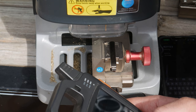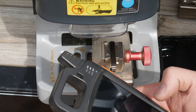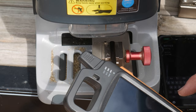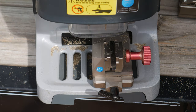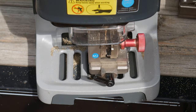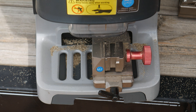Four, four, three. Four, two. Four, three. Two, one, three. Find bitting. Okay, so that is a valid key code. I don't know if it's the right key code or if my A and B could be reversed, but what we're going to do is cut a key and try it in the door. We will cut the key — cutting the other side. So we have a key now that has been cut. I forgot to bring a file with me, so I'll just scrape it back and forth on my trailer deck here to take off any burrs or ridges. I shoved the key blade into this plastic head and it looks like we got it.